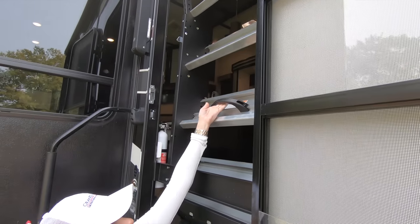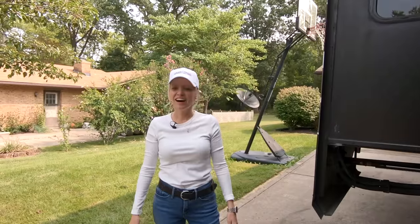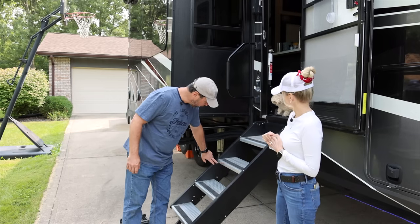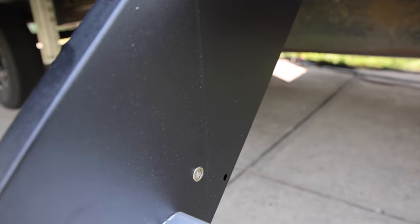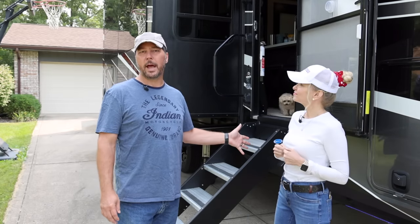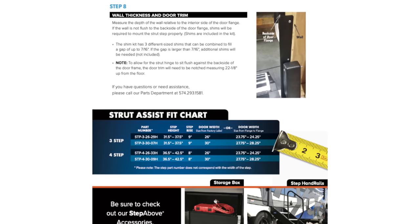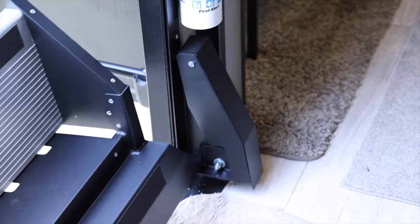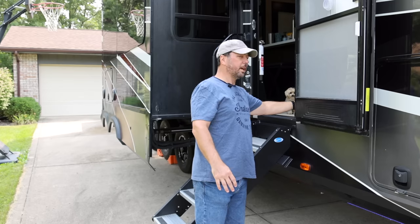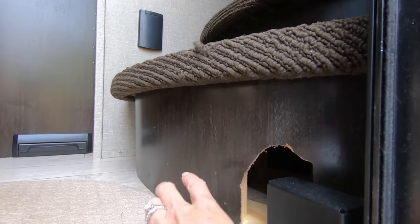There's also a cool handle here, which is much easier to use when you're not on a driveway with a five-degree slope. You may also notice that there are a couple of screw mount points here — that's for an integrated handrail so you can have a handrail built in that just folds right up with it, but it's solid and attached. Chad actually installed these himself. They were not that difficult. He installed both the first generation and these. They have a tool online that will help qualify you for the proper step for your RV. The things to watch out for: you've got your strut assist, so you want to have room for that. There's also a little block that required making a small notch in the stairs to fit.